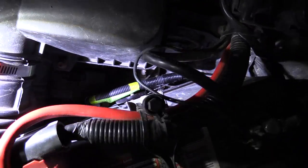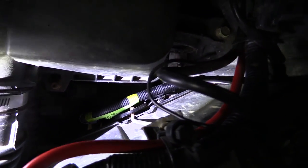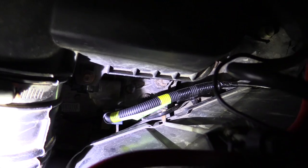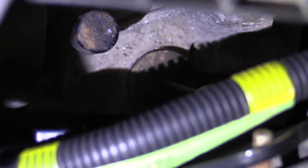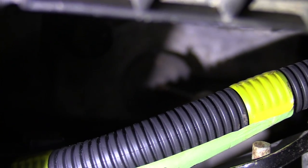Now I have some light on it. You can see just in here past the battery terminal down there — there's that plug. Let's zoom in on it and see if I can get better light. There we go — there's our dipstick with the yellow handle. Automatic transmission fluid dipsticks are usually yellow. I can't really see behind that wire, but it's there. I'll show you once it's out — it'll make more sense.